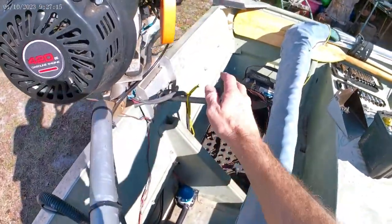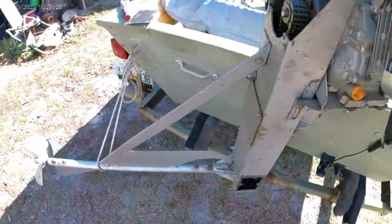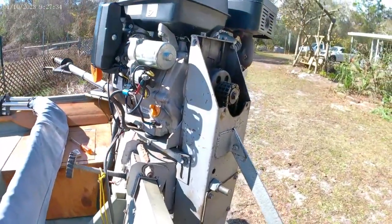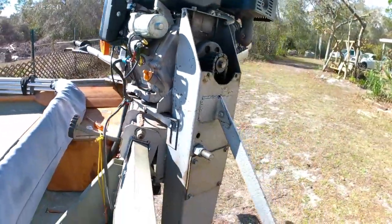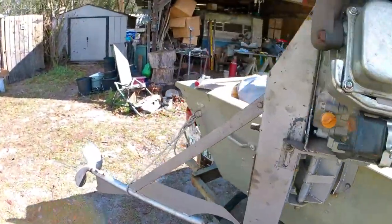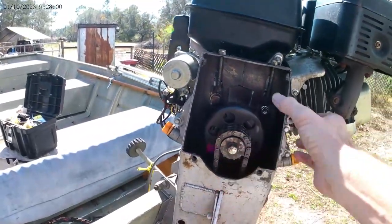I added a trim so you can just lift the motor up and turn it out more — that's a good deal versus what the plan had, which is okay as a backup. I've read too many reviews and watched so many videos, so I figured it was only fair to do one covering everything I've done, for anybody that's going to build one of these. The chain and all the sprockets are for Mudskipper mud motors. The chain that came with the kit was way too small, so I had to get one from NitroChain.